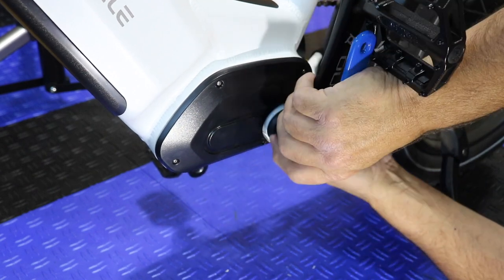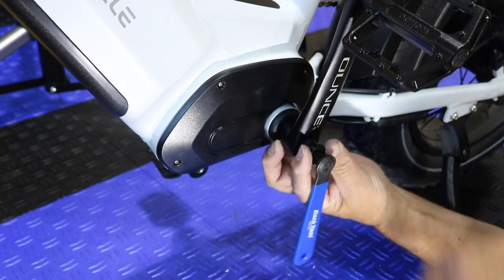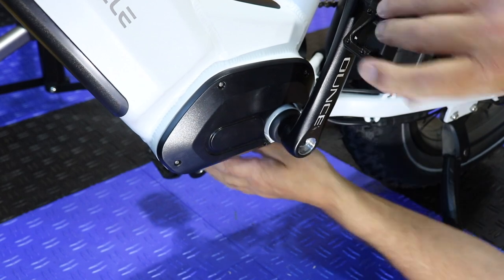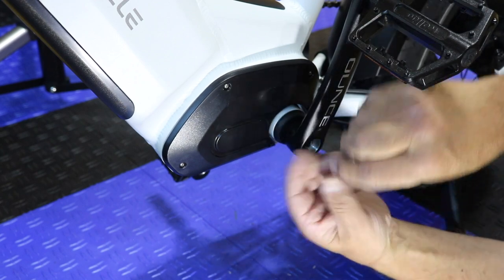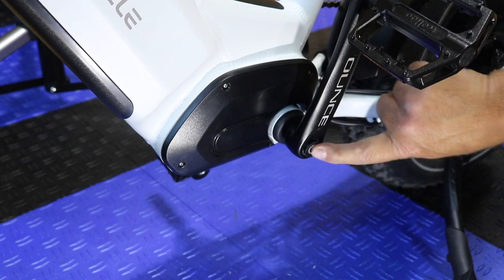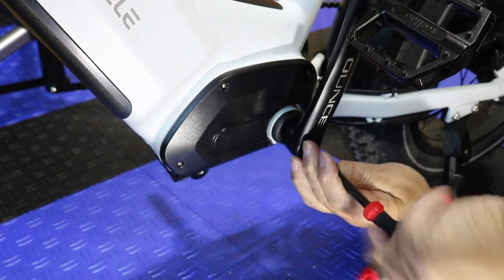Now the last thing we need to do is make sure you're on the opposite side of your pedal. I left this all together from the last time — guys, I can take anything apart. Now that's where it should be. Take the screw and screw it in. Then get an eight-millimeter wrench and tighten this down until it sinks back in. Put your eight millimeter in and start cranking it back down.